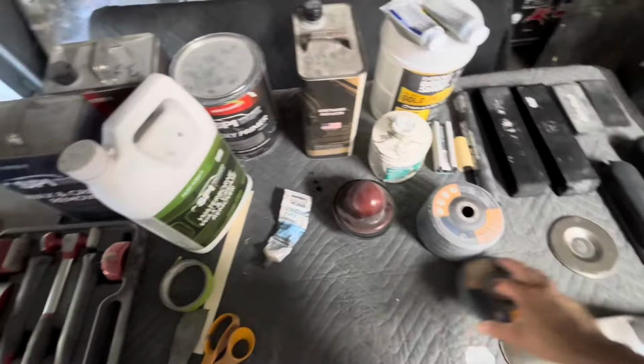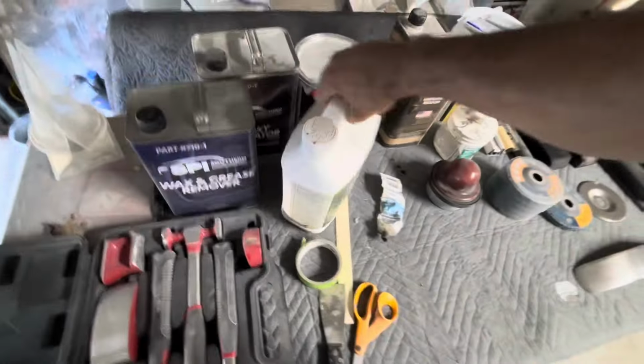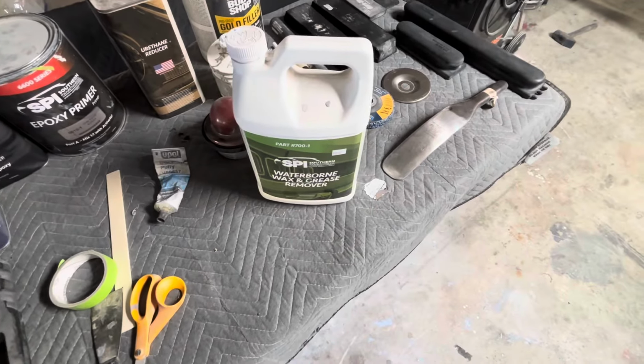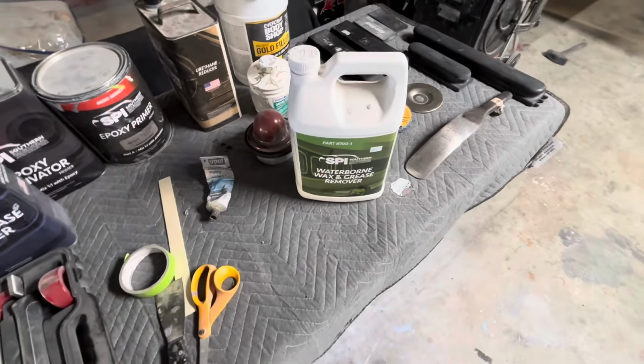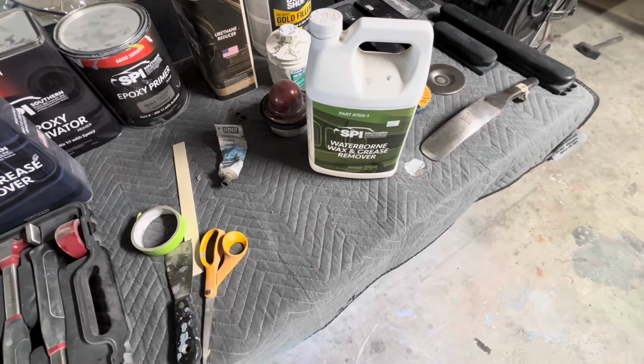After I got the panels in bare metal, this is a waterborne wax and grease remover that is recommended for bare metal. This is an SPI product. That's the part number. So you use this on bare metal and man, it cleans it up really well. So after that,